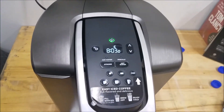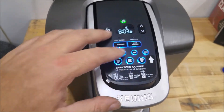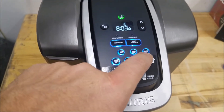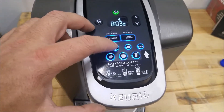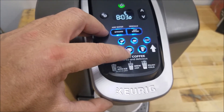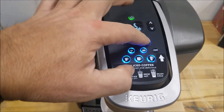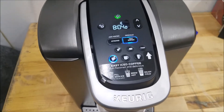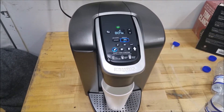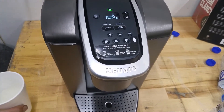For your cleansing brew, it's real simple — stick a cup under there and open the lid to activate the buttons: strong (makes your brew stronger), hot water (which we'll use), iced (for iced coffee), and then the different sizes: 4, 6, 8, 10, and 12 ounces. My only complaint is I wish the sizes were labeled more clearly. Select hot water and for the cleansing brew you want to do 8 ounces. Once it's done, take the water and dump it down the sink — you don't want to use that water for anything.